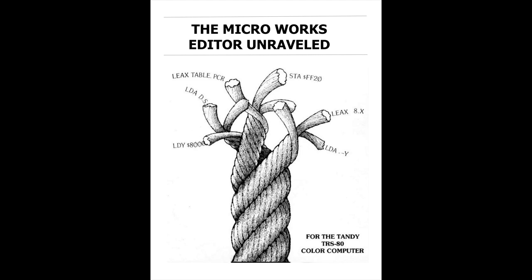And now we come to the write program. I'm guessing it does the opposite of the load program. You got it. The write program takes the text that's currently in the editor's memory, specifically the data from BGRAM, the start of free RAM, to TXTPLO, the end of the text, and writes it to a disk file that's already been opened by the basic loader. Okay, so it takes the text from memory and saves it to disk. Is there any character conversion going on here, like with the load program?